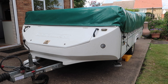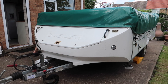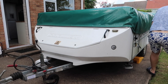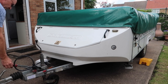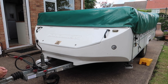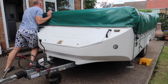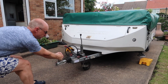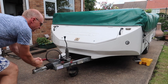If you have only got a couple of clicks on the handbrake and you try to push it backwards, with two clicks on the handbrake you'll be able to push it backwards but can't pull it forward. If you pull the handbrake fully upward, you will not be able to pull the caravan forwards or backwards, because you've got energy in the energy store. What I'm showing here is: I can't pull it forward, but I can push the caravan backwards with two clicks on the handbrake.